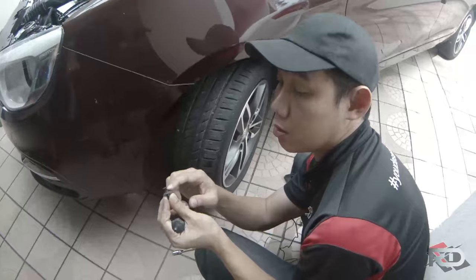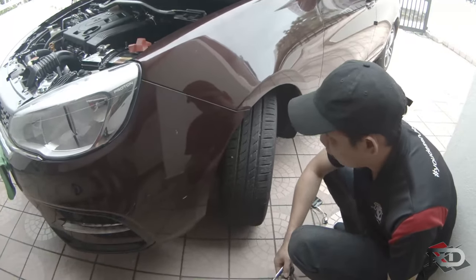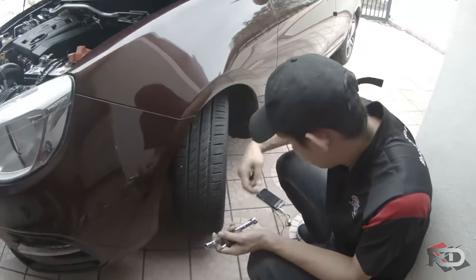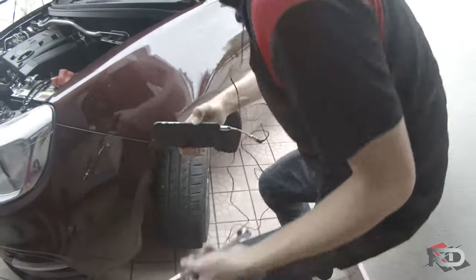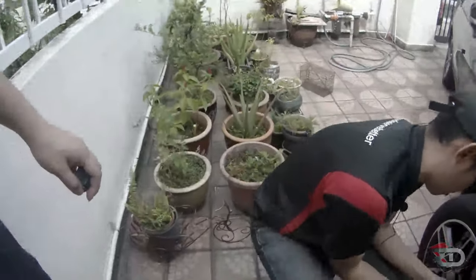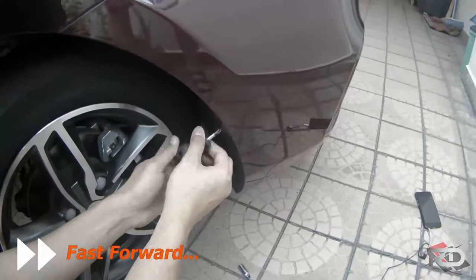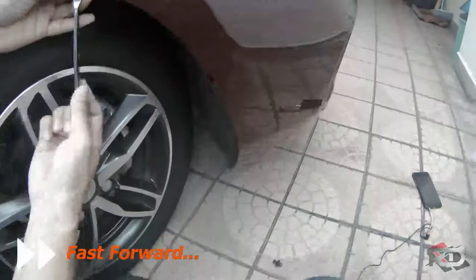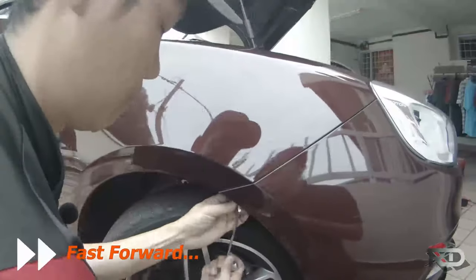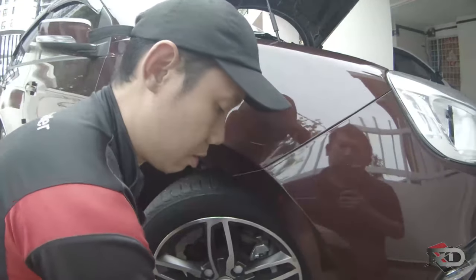Because the clips here will be very fragile. So when you open your front bumper, it's better to rotate the tire to one side. It's easier when you put in a screwdriver or any tool to dig in. Done — now to the bottom part.